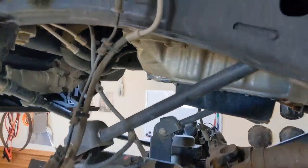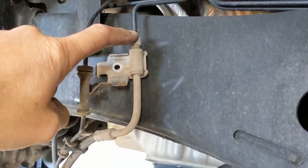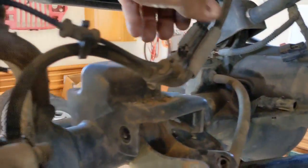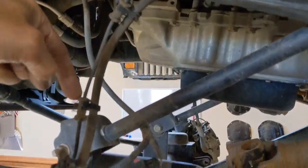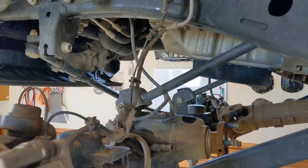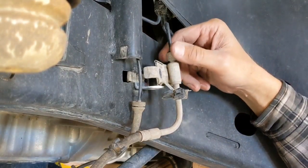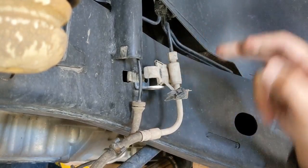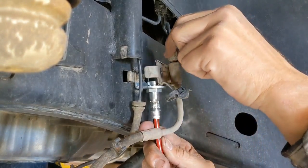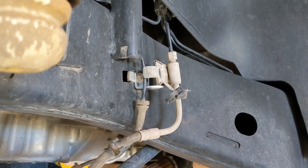As you work through this, we get to the brake lines. We've already undone the bracket up here. Next, we'll have to undo the brake line here, and what you need to be aware of is that brake fluid is going to come running out — if you've never dealt with brake fluid, it's a mess. Make sure you have a trash can or bucket below to catch it. The bracket I had to pull off the axle housing is attached to the brake line, and that's all going away because we have the extended brake lines. Disconnect all the ABS electronics from the main brake line, then pull that brake line off and get the new one installed. With this kit, I attach the bracket to the frame first, then take the new brake line and put it up between the frame, get the clip on there, break the old connection, and immediately attach the new one to minimize the mess.